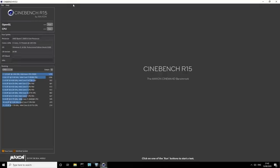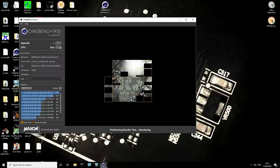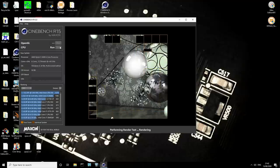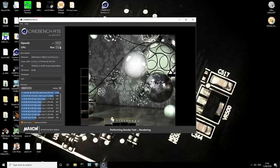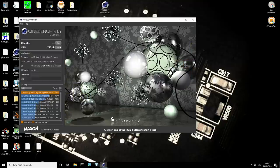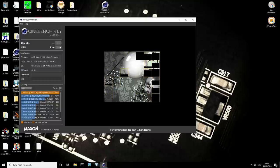Anyway, let's get Cinebench. And actually, we don't need hardware info, because we know for a fact that this isn't going to overheat. And, okay, so CCX0 is the weaker CCX on my CPU. That's fun. And I'm not sure that that's actually a major concern. The thing I'm wondering is, if CCX0 is worse than CCX1, single-threaded applications are probably going to prefer running on CCX0 compared to CCX1. So, yeah, that's not great.